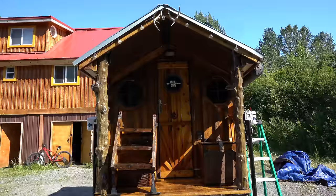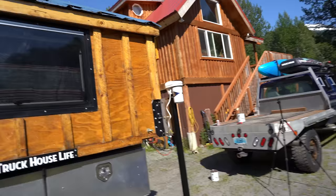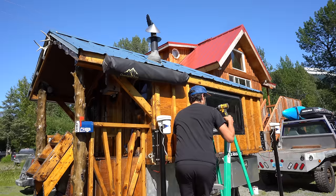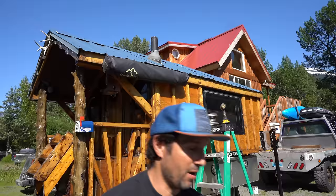Guess what everybody — we're done. The entire camper has been varnished. It took about three and a half to four hours, but everything is super coated, nice and glossy. It's going to take about 12 hours to dry, then we'll put it back in the truck. My next project is removing my wind directional chimney cap — it's been custom made, but no matter how many times I grease those bearings, the heat from the wood stove melts out even high temperature grease, and every time it spins it makes horrible noises that make it hard to sleep. Since I'm going to be on a road trip mainly in the fall, I won't need the wood stove until I get back to Alaska. The new solid chimney cap is also significantly shorter, which saves clearance when off-roading through trees.